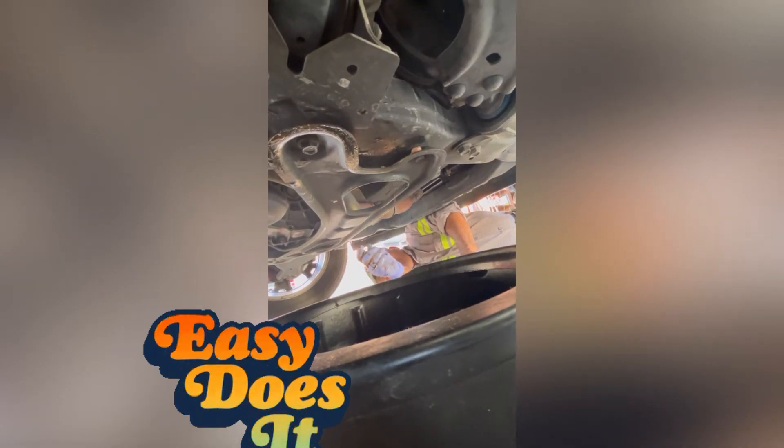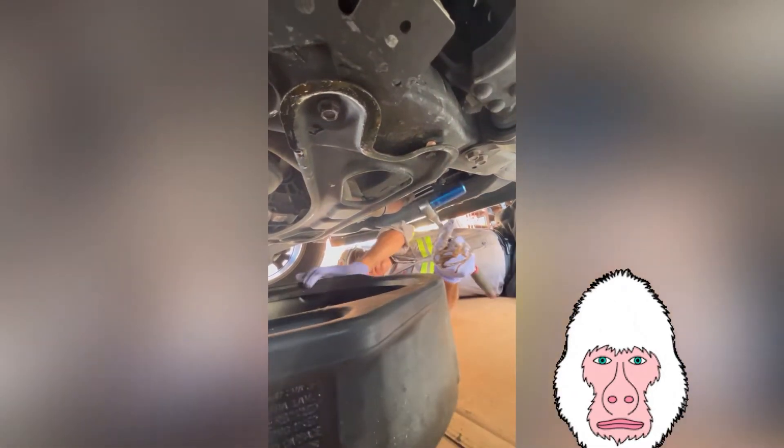When the wind starts blowing you got to be careful — don't let it blow all over the place. It's very easy to do. If you don't have jack stands, just go up on the curb where you're at and do it from there — just in case you don't have jack stands, that's another way to do it. Snug it in nice and tight, but don't gorilla tight it because you'll break it — it's a drain plug. One, two, that's all it is.